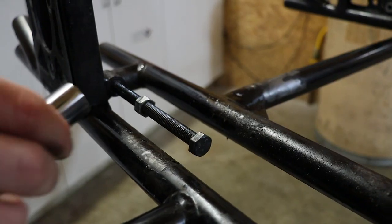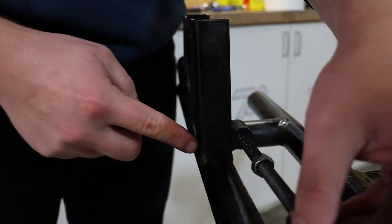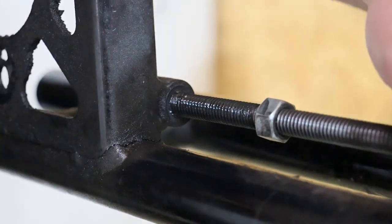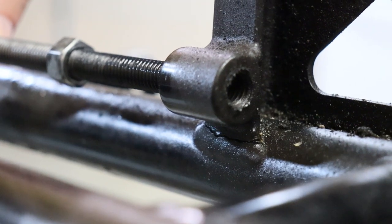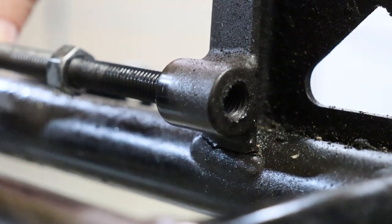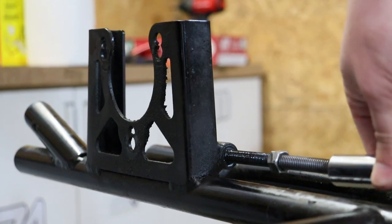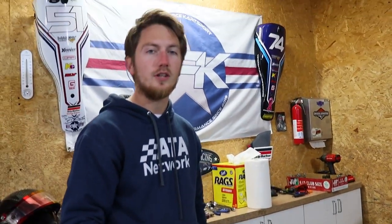12 seconds later — what I did learn in our process here taking this bolt out is we very visibly have a crack. The weld actually goes here and there's a weld on the backside. You can see where it's pretty much this entire weld on the backside that is cracked, which means the entire axle area is messed up. Once we get this chassis cleaned up, this whole frame is going to have to go to Margay to get a reweld job done. It's good to note that you can sometimes see cracks like this just by tearing down before you even start cleaning. So unfortunately — or fortunately, depending on how you look at it — we have found a crack in the chassis.